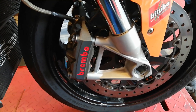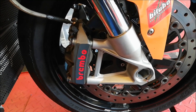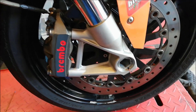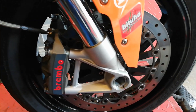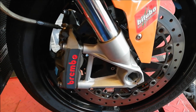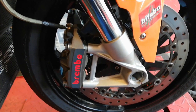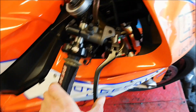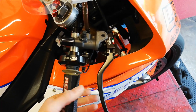This is the brake setup on my S1000RR. I'm actually not using the original calipers — I'm using Brembo M4 calipers almost entirely because they work better with the Brembo discs on my Marchesini wheels. Also an advantage is that the pads actually last longer and cost less. The only issue I've got at the moment is when I pull the brake lever, I'm getting quite a lot of movement before I get any bite.